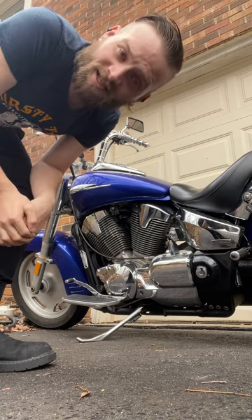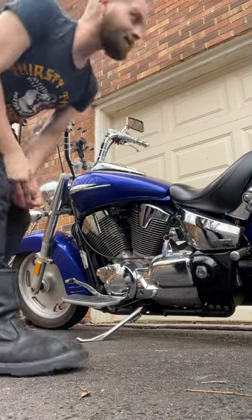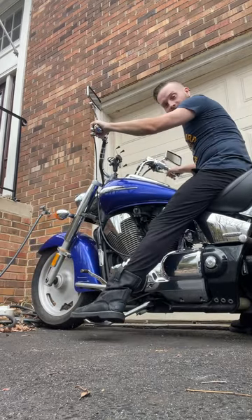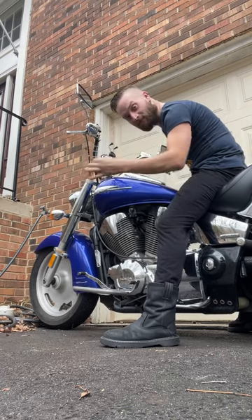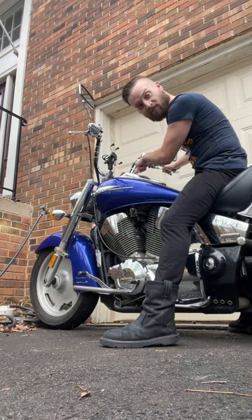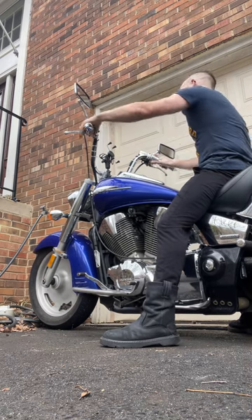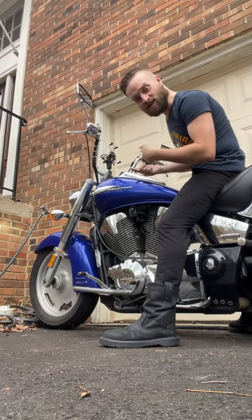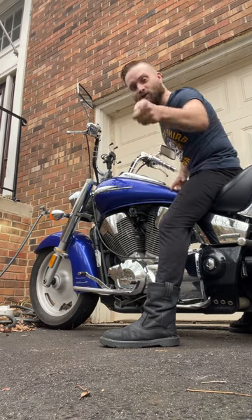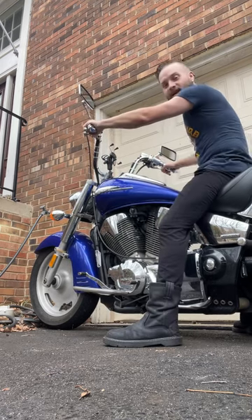Now I explained it — you want to see the whole process done from the very beginning? Let's go do it. I'm coming outside, I'm going to start my bike. Mount the bike, pull the kickstand up. I have my key — I'm going to stick it into the ignition. My fuel lever is in, I'm going to turn the key. I have a neutral light — we're good to go. My engine cutoff is off, and now I'm going to start it up. I've already started it so I don't need to pull the choke out. If it was really cold I would have had to pull out the choke. There you go — you and me have successfully started our motorcycle. Let's go for a ride.